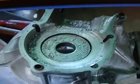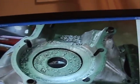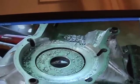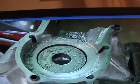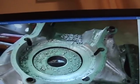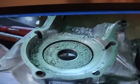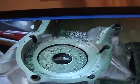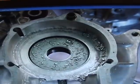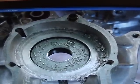If you have an air leak in your engine, what happens is you have a high idle because it's getting extra air into the engine. Now what you will have is extra air, and then it will go high idle, and then the idle will get lower and lower because the gas is leaning out in the engine. Then it'll quit. And a good engine should idle all day long if it doesn't have any air leaks.